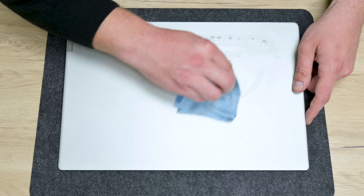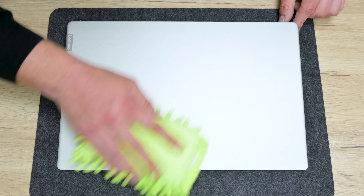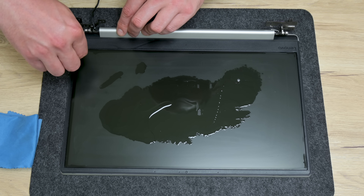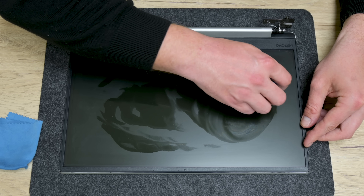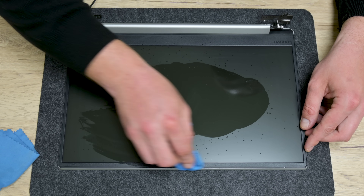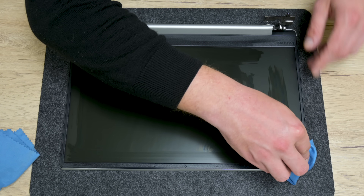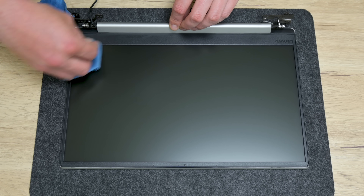Now I continue cleaning the whole top case. I found a few very minor scratches, but in general the case is in very good condition. To clean the display, I used soft cleaning cloths, cotton buds, isopropyl alcohol mixed with anti-static glass cleaner, and brushes. I didn't remove the bezel because it's already well-stuck — the factory glue holding the bezel is always better than aftermarket glue. Sometimes I do remove bezels, but only if the bezel is easily removable and dust can enter inside.